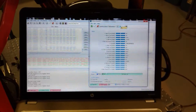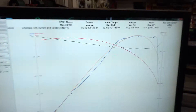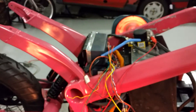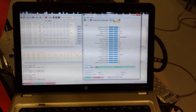I cranked up the master current limit for the battery to 600 amps. I don't think that's going to matter, but I did a check in my last run — my peak current hit 473 according to my dyno. I did the best I could to calibrate that current sensor as accurately as possible, and I thought that was high because this is a 400-something — 450 peak amp rated controller. Nonetheless, it's a size 4 Sevcon.